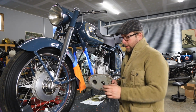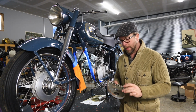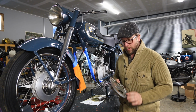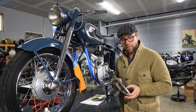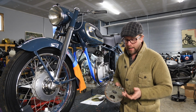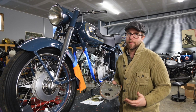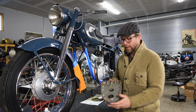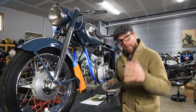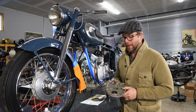All right, so I did a bunch of digging online, called a few people. Thanks again to Todd Trumbor. He owns a Bergmeister, ironically, semi-locally, about an hour away from me. And I spoke with him at length about the oiling issue and the breather issue. After getting his take on it and reviewing the manual and some other stuff I found online, the breather was actually set up improperly, not allowing any crankcase pressure to be relieved. So this, you can hear as I suck on the breather tube, it allows plenty of air to pass. It was actually flipped, where it was the opposite, when it wouldn't allow any air out.